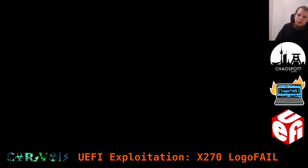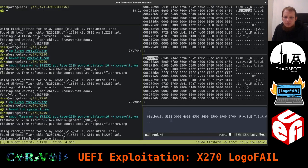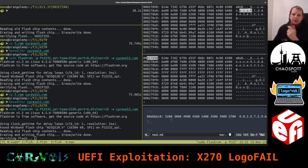So I hope this is not too boring, because it's actually very repetitive and not too rewarding. I'm going to stop this part after this here. In the next steps we're going to start doing some other funny stuff. So we now have a USB drive that we can use to boot our own system. What we're going to do is take a backup of the first blocks, the first bytes essentially, of that drive. Then we're going to edit those bytes, write it back to the USB drive, and see if we can crash the firmware with it.